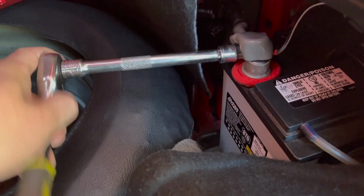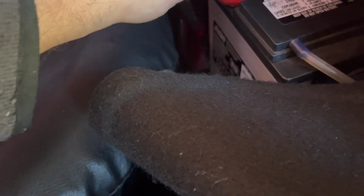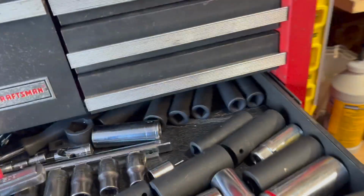So even this old OBD1 car still has some parasitic drains that are fine normally, but when you're trickle charging over the winter, it's enough to cause the charger to say, forget it. OBD2 cars and cars with all these fancy accessories, like newer cars like those two, the battery would definitely go dead over the course of the winter.